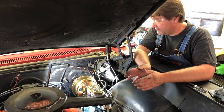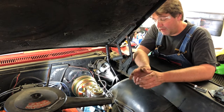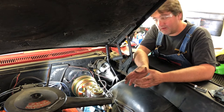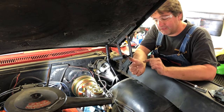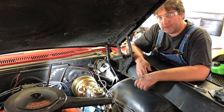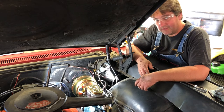Hopefully, by cutting off those studs, cutting them shorter, I save somebody the trouble of doing what I did previously. Getting the thing all bolted up, tightening it, only to find that the two studs hit each other and the master cylinder wasn't tightened completely against the firewall. We're all learning together, right?